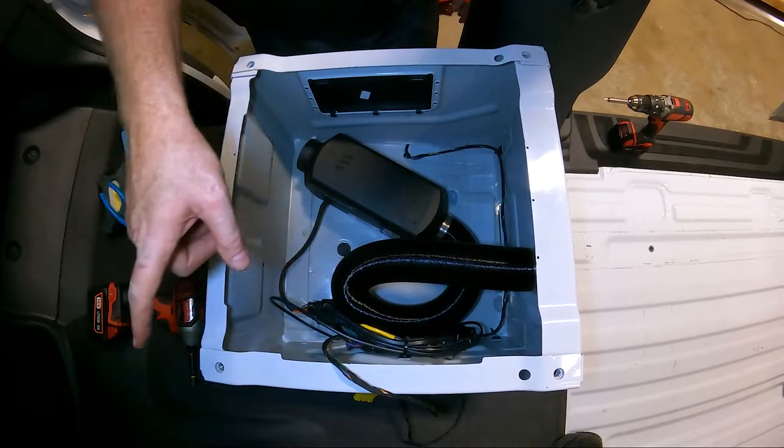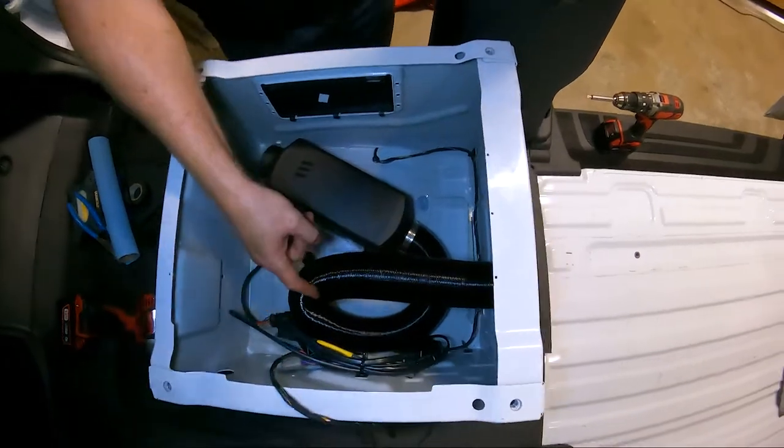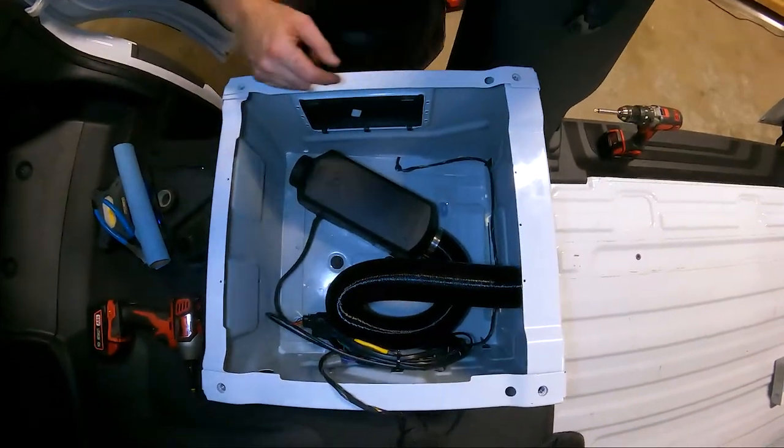They also give you this little vent cover that you can install on here. The best way to do this is to put it on your unit and tighten that down with the ratchet gun. Just twist it around and push it down here so it's holding all those wires against the side wall. Don't forget to put that on there. Everything's holding the wires against so they won't rattle. Everything's nice and secure. All the wires and everything are away from the unit itself because this does get very hot. Now next we're going to go over to the battery compartment, finish up the wiring over there to power the unit, then hook up the control unit and run that wire.